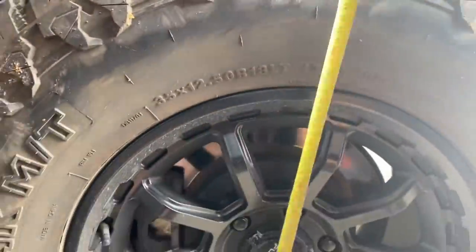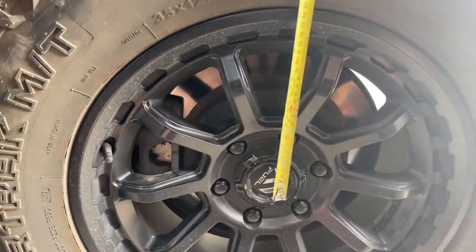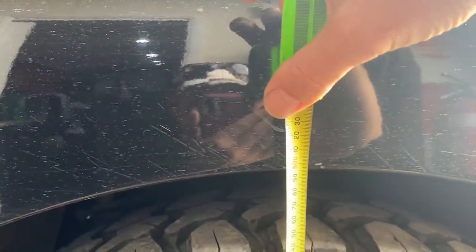We're doing a lift on this car today. It recently had a Razzler rear bar fitted, and there's a fridge and stuff in the back. Measuring the rear center wheel hub, I'm getting 490mm - probably a bit of parallax error - but that shows you how much weight affects these cars. They can drop down significantly with independent suspension.